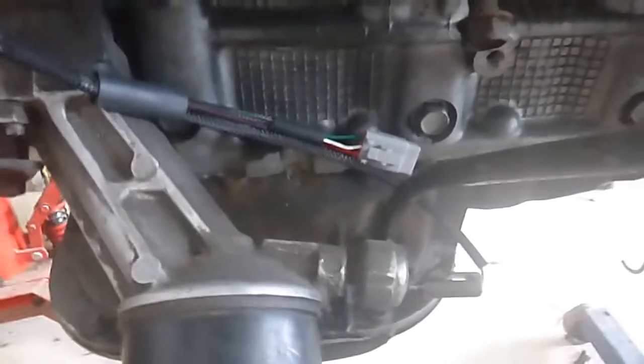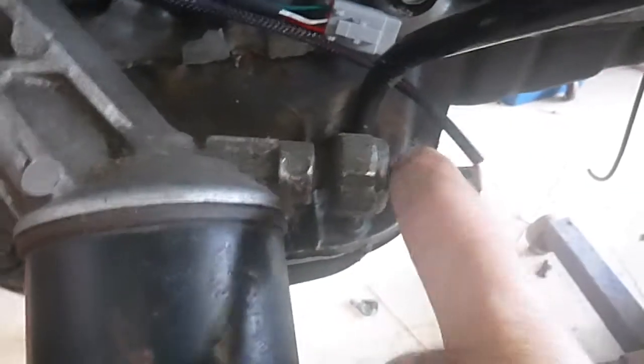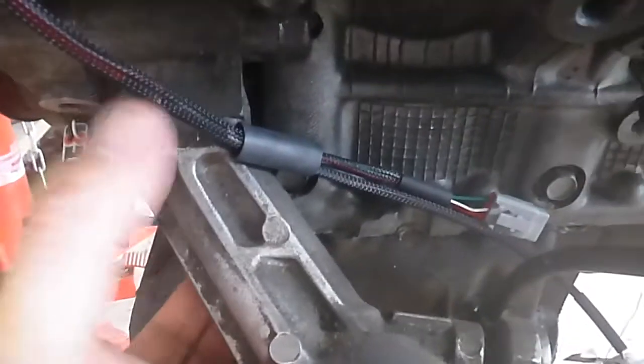That is running to the computer on analog volt — digital input one with a pull-up resistor. So you will see if you've got an oil light on there, and I've got a warning buzzer — I'll talk to you about that later. If I don't know what oil filter housing is on it — often on Hi-Ace they have remotes under the battery area. So if that's the case you'll have to build an extension lead. It might have an oil filter block up in here, so that's neat and tidy. With the filter coming forward it'll be in the same place so that'll all fit. And I tuck it in behind.